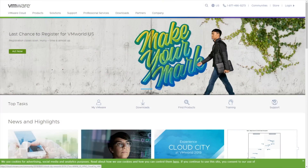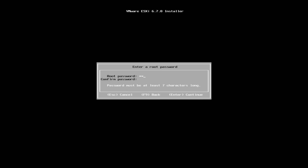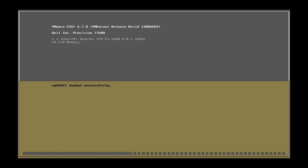Now it's time to power on the system, make sure everything is healthy and functional before we install our hypervisor, which is going to be ESXi. We're going to be installing ESXi on a memory stick that plugs into the motherboard. You can download the ESXi hypervisor for free from VMware — just create an account and download ESXi. Then, using the downloaded ISO, install ESXi onto your internal USB stick. Once the installation is completed, reboot the system and you're ready to get working with your VMs.